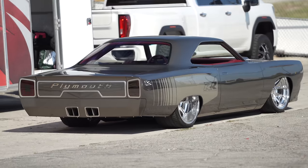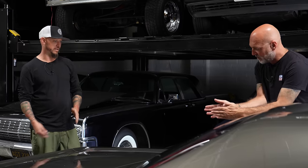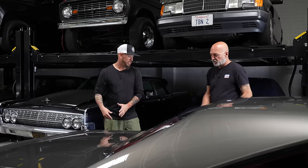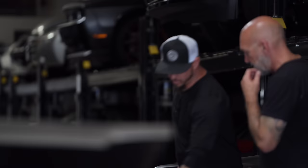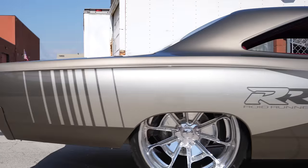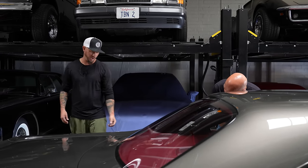We widened the rear quarters 1.5 inches. So from the top, there's a cut and widened. Add metal, widen it out. And then also through the planishing hammer, we made the hips wider, per se, the rear quarters. So not only wider here, but you also bring out the bow a little bit. You can tell the rear body line as it comes from the door comes from damn near nothing. And then in the middle, we not just raised the body line up, but we also made it, I guess, thicker, wider.